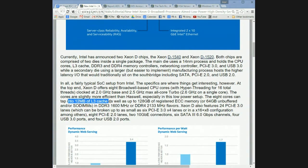It's going to be a nice little product from Intel that's going to be significantly less expensive than we were used to with the Xeons, but still comes with all of the extra bonuses, like it supports ECC, and they've fixed the TSX instructions. That errata is gone from this particular version, so again, it's going to be attractive for professional use. And at only 45 watts it is going to cut data center costs significantly just from cooling and heat output and power use. I mean, that's pretty amazing for a blade server based CPU. Yeah, and it was 12 meg cache. I found it. That's a lot. Yep.